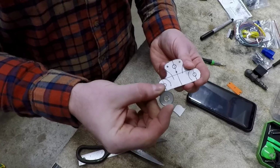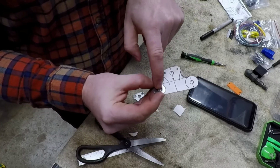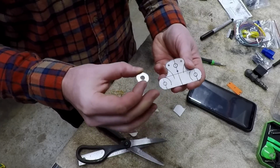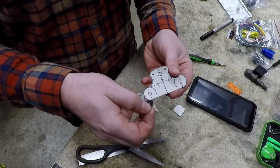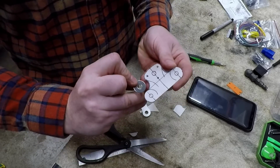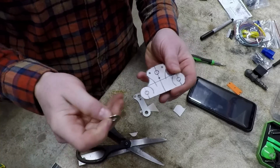So I picked a generic washer that I will be using as our guide for our mounting tabs on the actual triple. So this is kind of the area I want to build into the bracket to have enough stability. So we kind of cut around that. We have our center marks there where I know we want to drill our holes. And then from there, I just went ahead and radiused it just to make everything kind of flow.